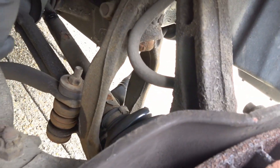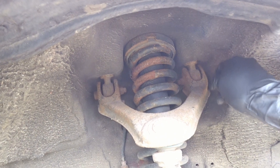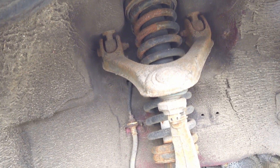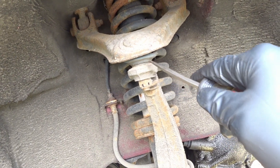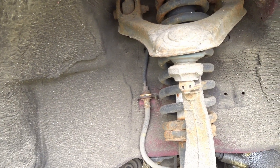Take that off, pull it out, drop that side out. Then take it off from the top — the two anchor bolts from inside the car — so the whole thing just pops out without having to mess with the ball joint. This one allegedly was a new control arm, so I don't really want to damage it just by taking it out.